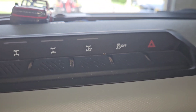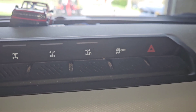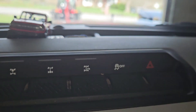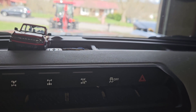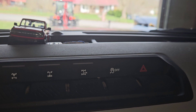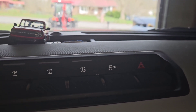What this feature does is: let's say you're trying to turn really sharp, you've got trees on each side, and you're trying to turn but don't have room to back up. What you can do is press this button and it will essentially use the brake to lock one wheel and create more friction on that side to enable the outside wheel to rotate more, turning you sharper.